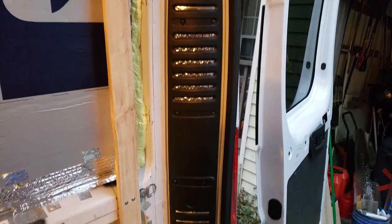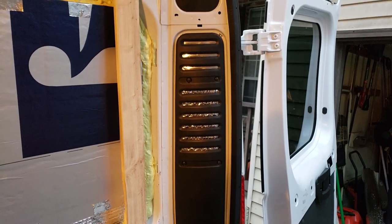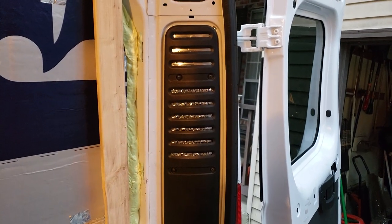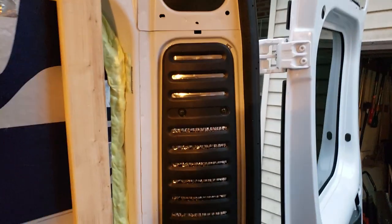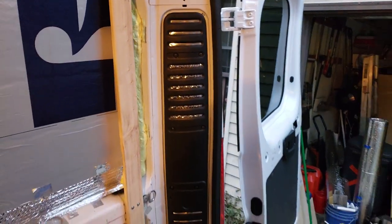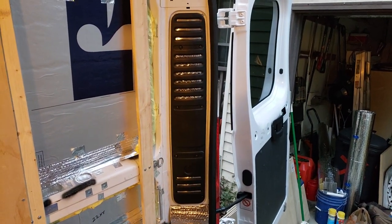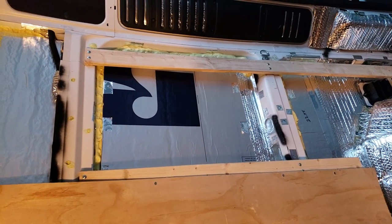There was a lot of cold coming in through these vents because of the open nature of them. I didn't seal it shut — I put Reflectix and some aluminum tape on the inside of it, so this stuff is taped to the panel but it's not permanent and doesn't seal up the cavity. There's still plenty of airflow from areas under the chassis that lead into that area.